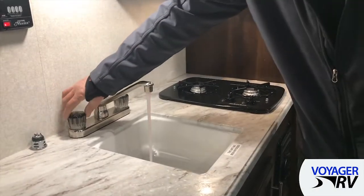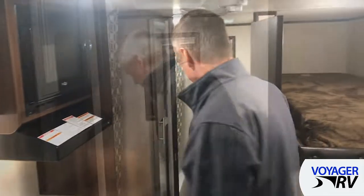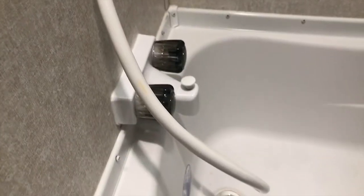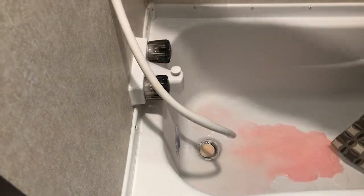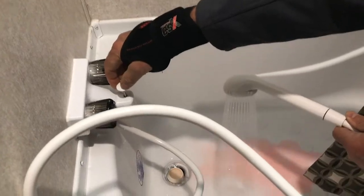Now we're going to run the cold tap — and that's that. Next, we're moving into the bathroom and we just flush the toilet until it runs clear. And now the bathtub. You see how much quicker it is now that the lines are starting to get water in them. Let's make sure that the shower is working as well — it's all good. So now we've flushed all the antifreeze out of the lines inside the unit. The last thing to do is to make sure that you flush your outside shower. This particular unit doesn't have an outside shower, so we don't have to worry about it.